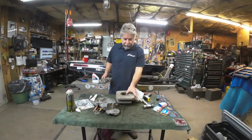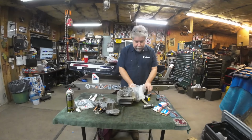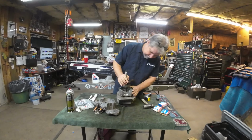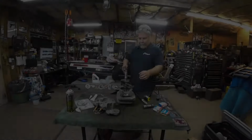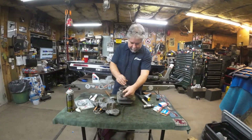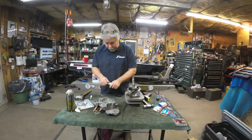All right, I got my Fuji 250 engine stand here, which is just an old ATV cylinder. And we'll drop the crank in. Get the crank nice and clean in a plastic bag. It should just go. Shouldn't be fighting me. I might want a little rubber hammer action. There we go. Seems awesome. The point of that cylinder is just to give the PTO end somewhere to go.